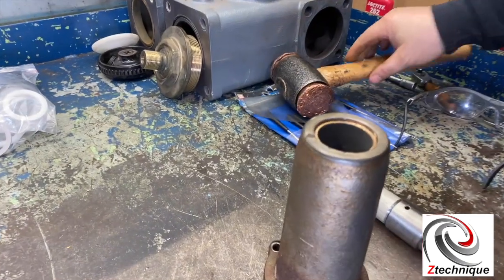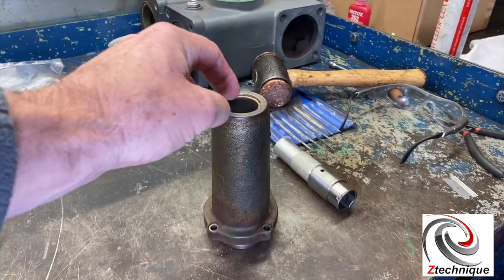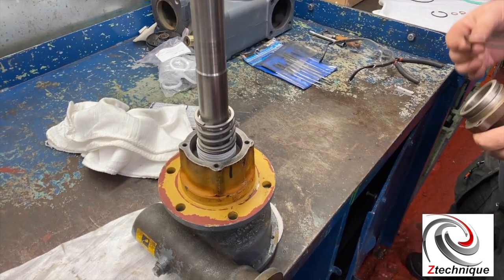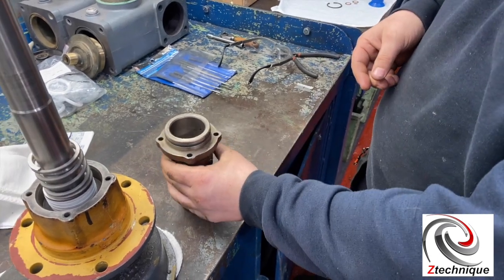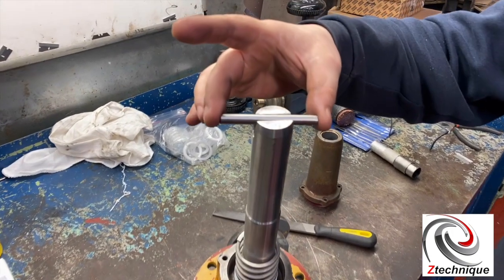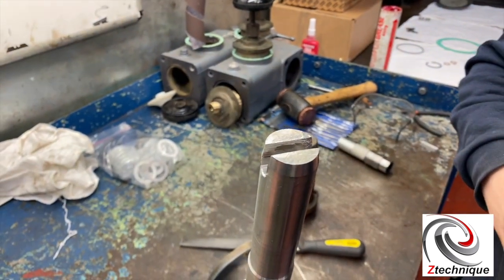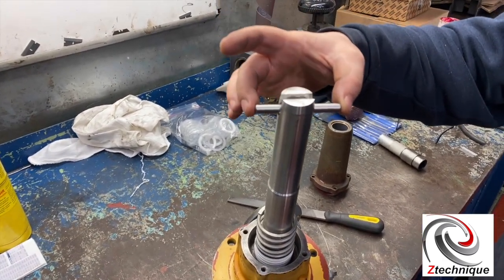It's going to go down to the bottom — there's a little lip there. We'll just check that edge before we put it onto the shaft and the housing itself. We've just cleaned that up. Now we're going to put an O-ring on it. You can put a bit of grease on there as well, which will help with the sealing. Before you actually fit this assembly back in the machine, you should check that this gap has not deviated inwards, which will obviously be a problem when you have to put the pin into the MD drum itself — just make sure that that's a nice fit.